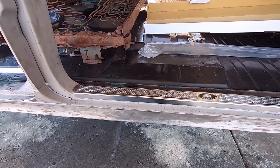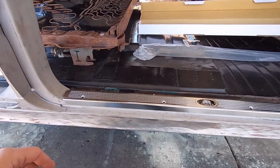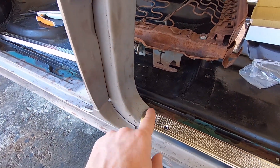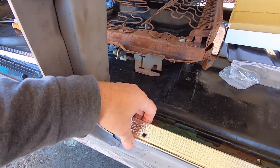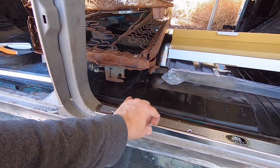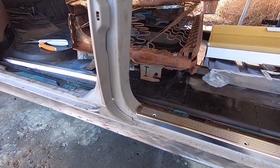The other reason to mock up your door seal plates when you're in the metalwork stage — while you have clean metal — is that you have to bend these ends a little bit to get them to fit the body contour. I'm going to use my hands and bend these to contour the body slightly. If you try to push them down after paint is on it, it will gouge your paint. So just thought I'd show that.